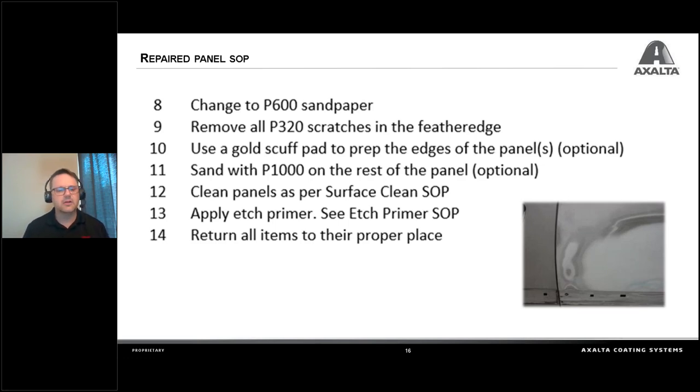At that point, we can change to 600 grit and start cutting out the 320, and back sand a little further on the panel with 600 grit so our primer overspray will bite in and has something to stick to. The worst thing we can do is spray primer and go past our sand scratch onto unsanded product — that will have an adverse effect when we're done. At this point I can do the blend panel prep. Take a gold scotch pad — people tell me they use a gray scotch pad and it seems to work, but could we do a better job? Yes — use gold. Gold scotch pad is 800 to 1,000 grit equivalency, gray is P500 to P600, and red is P320 to P400. Use gold in those areas, get the edges first with the gold scotch pad so I don't push the dual action sander with P1000 too close to my edge and cause a burn through. Then clean the surface and apply etch primer, usually one coat with a flash time.